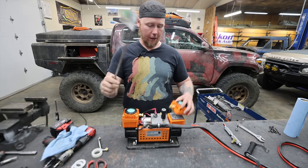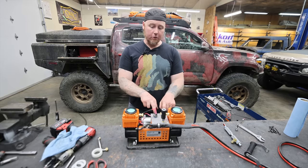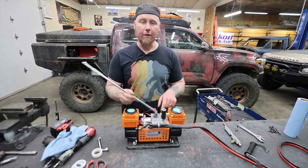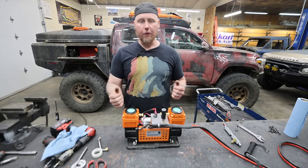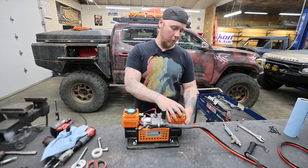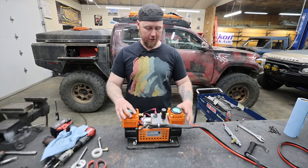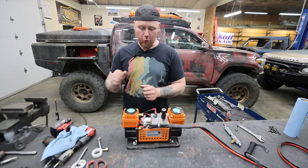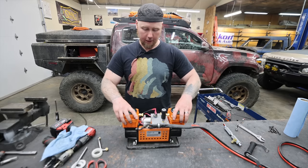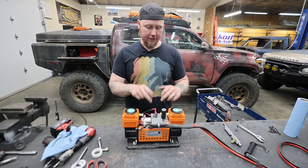We're going to use more of this cheap soft copper that comes in the form of a hose flex connection for a faucet or kitchen sink. As you might remember from the last episode, I talked about how this manifold's expandability works. We're going to exercise that expandability and dump both of these into the manifold independently. As far as that chatter — I shook everything I could everywhere, and the only thing I could find is that one of these heads loosened up just a little bit, giving me a little extra noise. So on final assembly I'm just going to tighten everything down a little bit more. I was too soft before because I didn't want to damage the O-rings, but I think we can tighten it up more and get rid of that noise.